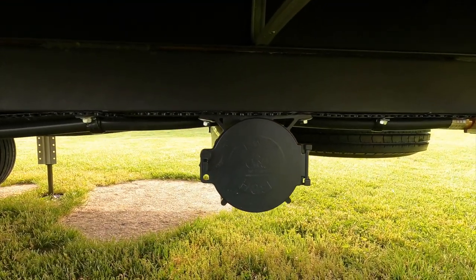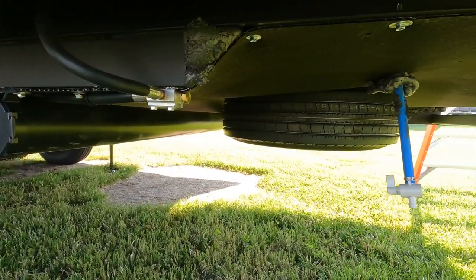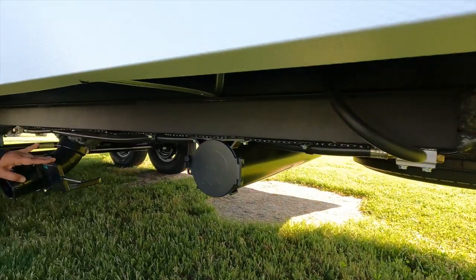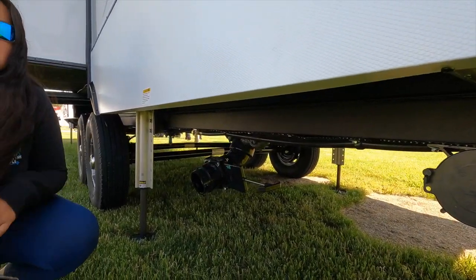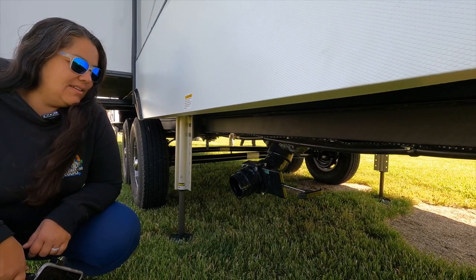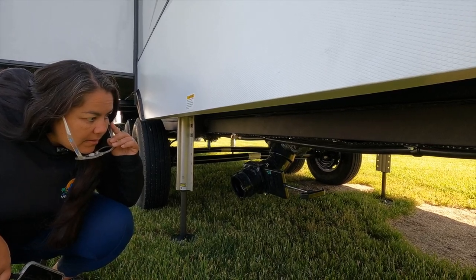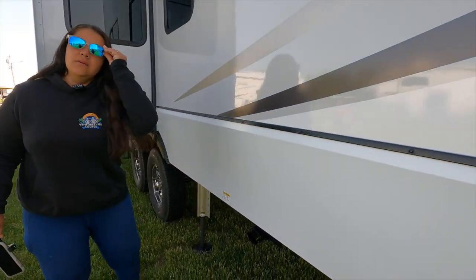And they put a stinky slinky holder in there automatic. And then the blue one there is your low point drain. Yeah, don't forget about this baby right here. That's a necessity on any coach. Yeah, that is a Valterra style valve. I don't know if that's particularly the brand, but it is a wastegate valve so that you don't get any surprises when you open it.